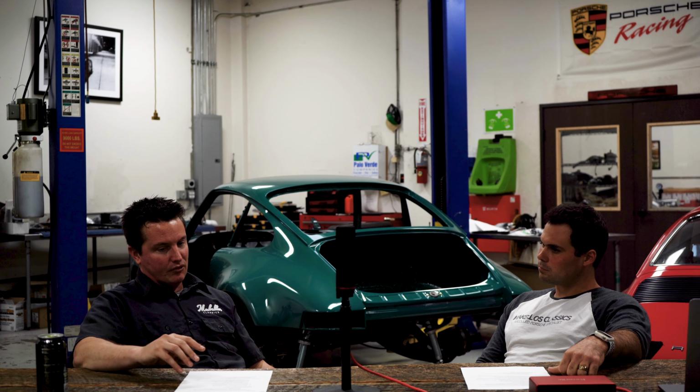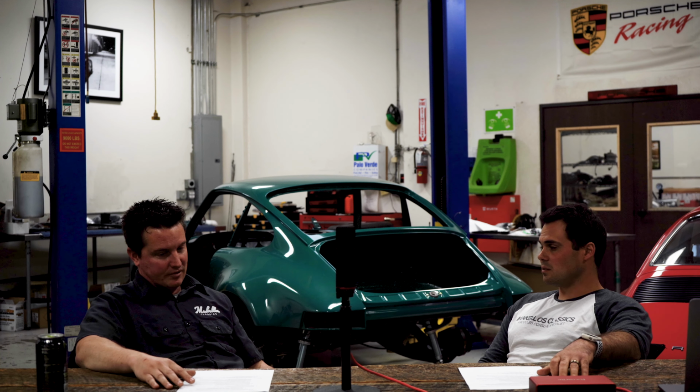There's a few others, like thermoplastic, that provide the same characteristics as bronze, but they're a self-impregnated, self-lubricated plastic. So in the realm of rigid bushings, I really like those. If you're a really dedicated track car, but for a street car, I wouldn't go with them. Polygraphite's a great setup for the street, and we haven't had any customers complain about those. Even if you have a stock car and you're just trying to go one step up, it's a nice little addition. Then you go to the peak, and that's monoball and Heim joints, your 935 setups.